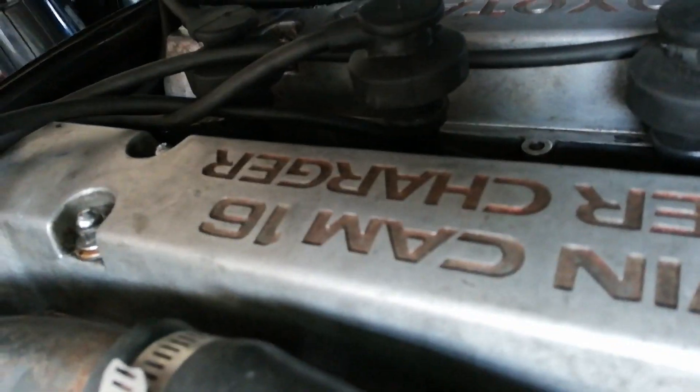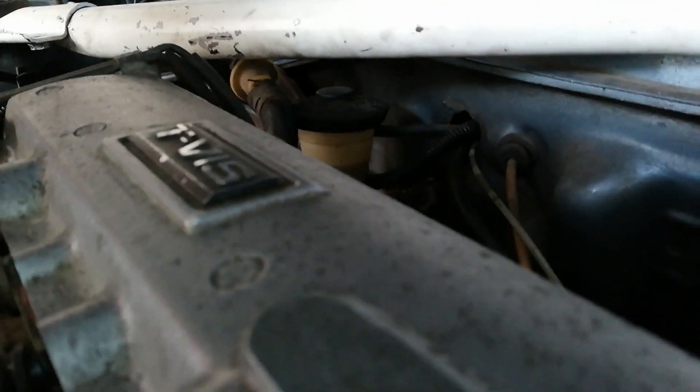I checked mine — it's coming from the intake. I put the screwdriver against it and heard it clearly — it's literally coming from the intake. I'm going to put the phone there so you can listen. I first thought it was maybe a shim noise, but it's not. I checked from the head and there's no noise coming from there.